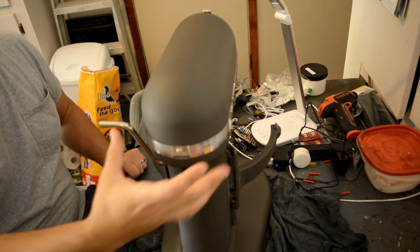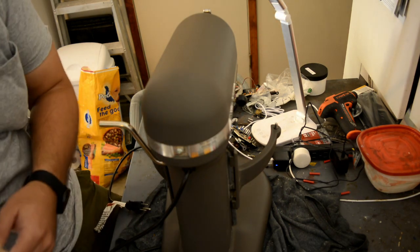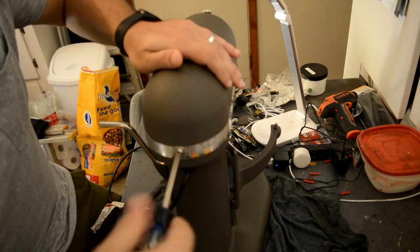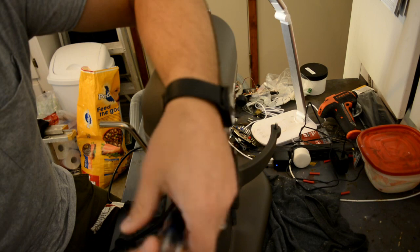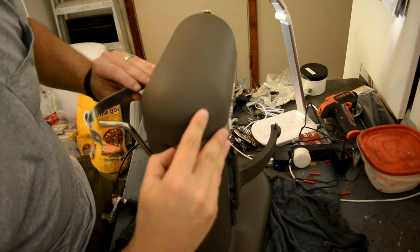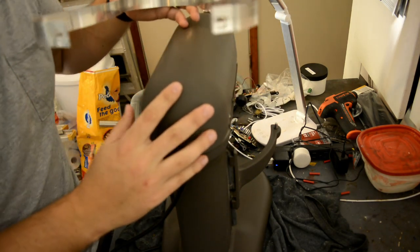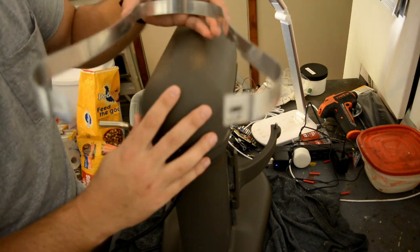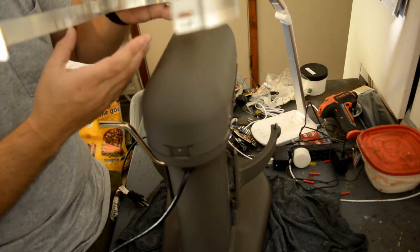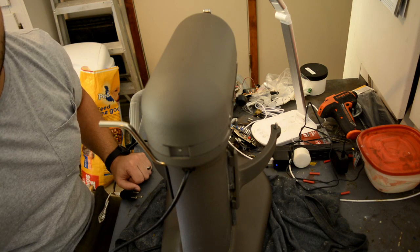Let's start with some disassembly. First we want to remove what they call the beauty band — this silver trim, and yes, it is beautiful. To take that off, all it is is a Phillips head screwdriver. There's one screw back here — you're just going to lefty-loosey. You don't want to do righty-tighty, otherwise you're going to strip that out. Once we get that removed, we pull that out, and that's going to allow the band to pop off. Now this is actually a really clean machine, but over time oil and grease separates — that's why we recommend to re-grease. You'll notice oil and grease lining the insides of this band where it leaks out of the machine. So that's one thing you want to look for. Make sure you clean it — just wipe it down with a rag.